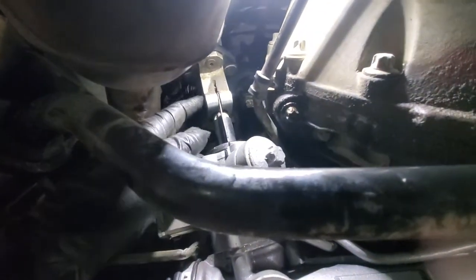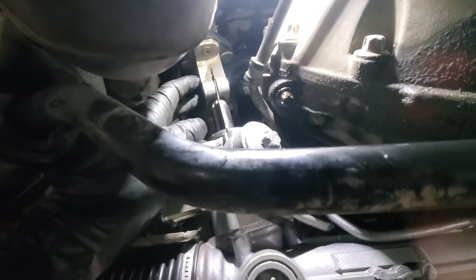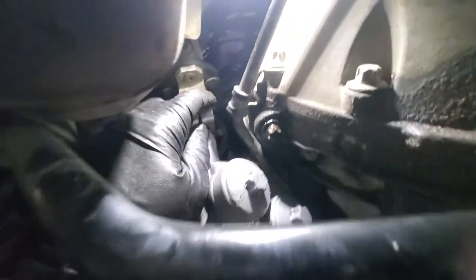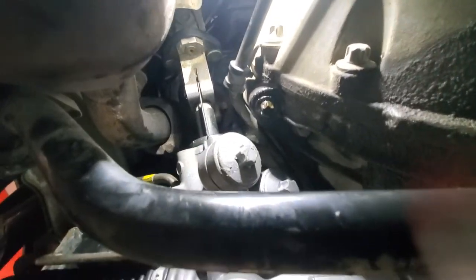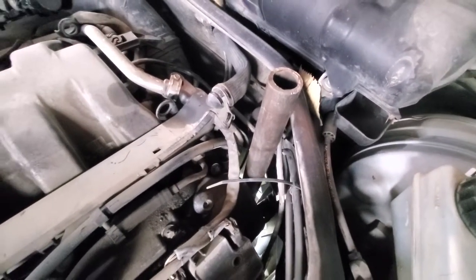This linkage is giving me a bit of trouble — it doesn't want to go in easily, and I assume that's because of those damaged splines. What I'm doing is placing a pipe on top and gently hammering it down — and it seems to be working. The pipe sits just on top of that new joint and if I tap from the top it moves down to where it's supposed to be.